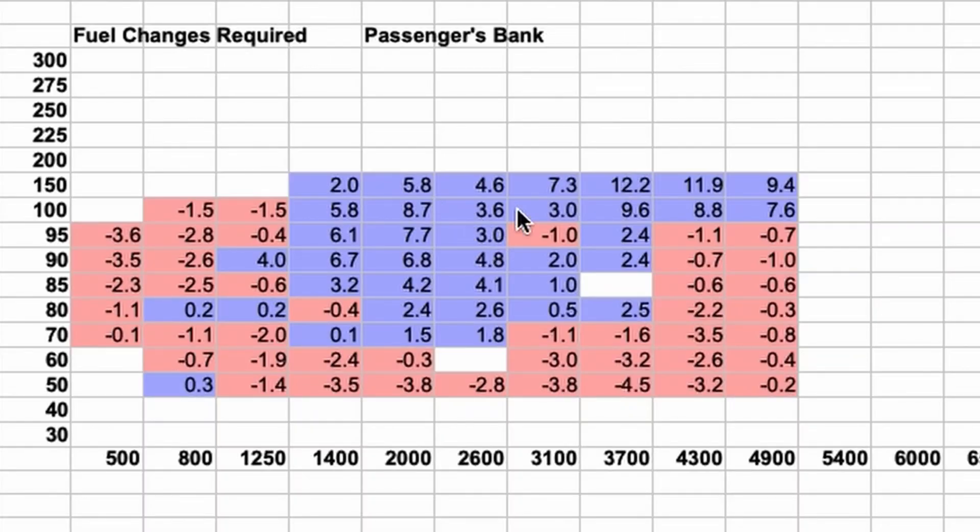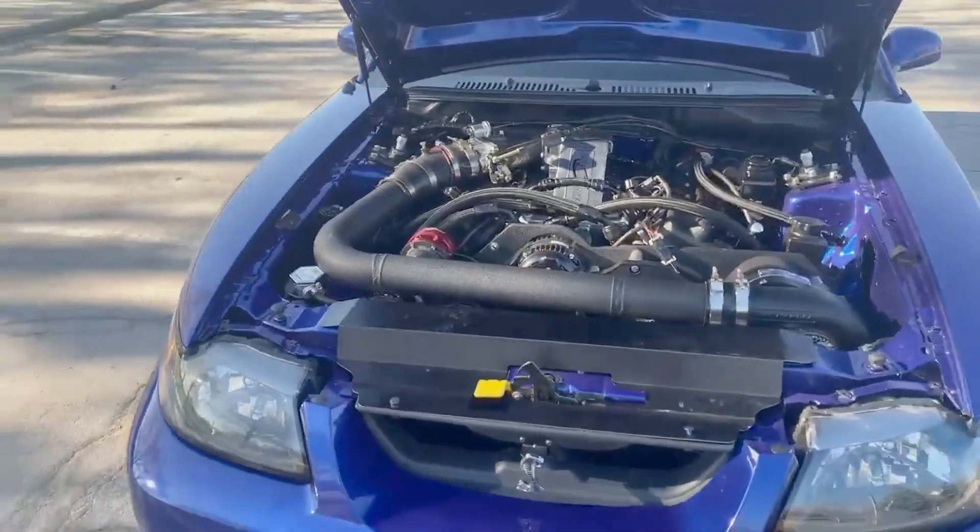Look at that — wow — completely different. This is all saying it was lean and needs fuel. They had 12% fuel up top here; this is about seven pounds of boost, so it's really not much at all. This car has a big F1 ProCharger on it, it's going to make 30-plus pounds of boost. We're just lightly rolling into it, just kind of getting the car started and feeling it out, and this is really an eye-opener.